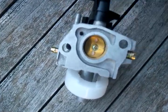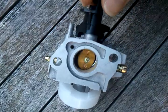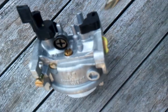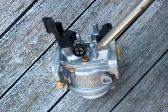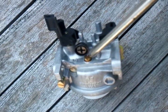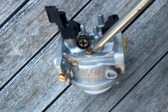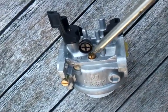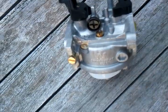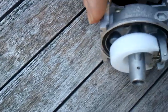If you have this problem, this valve here may be the culprit — may be dirty, may need adjusted — though not particularly likely. Most of the time that's not going to change. What you are going to find is right here: sometimes on one of my carburetors this is actually a little black piece of plastic that you can pry out. On this carburetor it's actually a screw jet, and you can unscrew that, clean it out, make sure that the port — that port actually goes down underneath here — and you can't really make it out too well because it's underneath the float there.